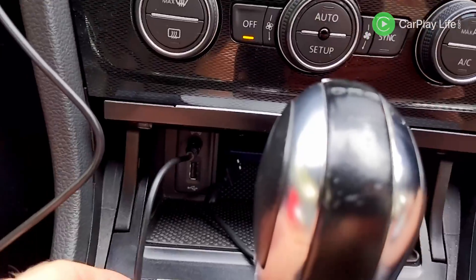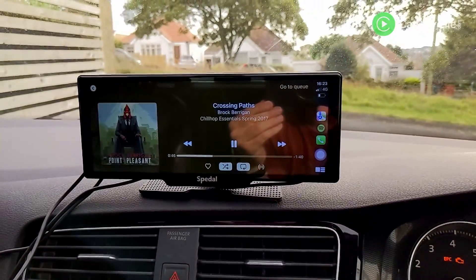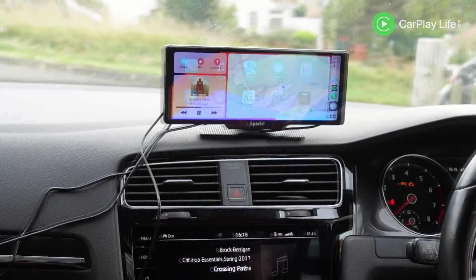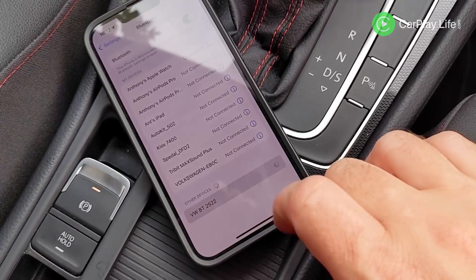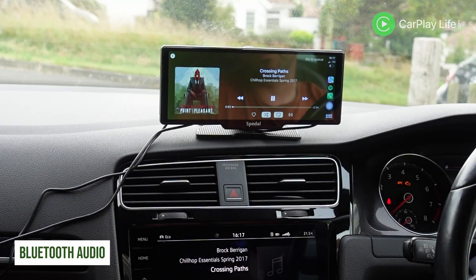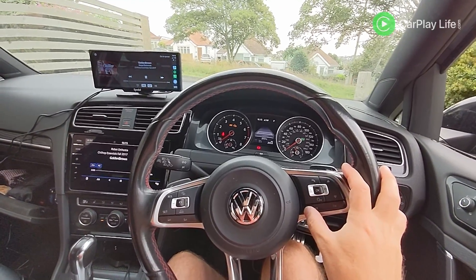Connecting the AUX cable between the car stereo and the display is the next best audio solution in terms of quality. There is a little interference from this output method but nothing too significant to affect listening, though being wired means more cables and it isn't visually appealing for a clean installation. Finally there is Bluetooth audio — the best wireless audio output solution if your car stereo has Bluetooth. After pairing your phone with CarPlay or Android Auto, the display reconnects your phone to the car stereo to share audio, and your steering wheel controls will also work at this point.